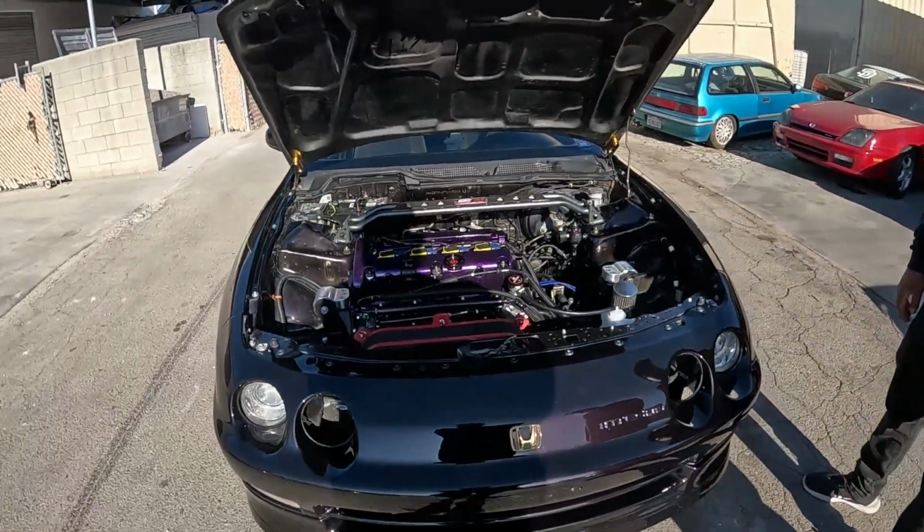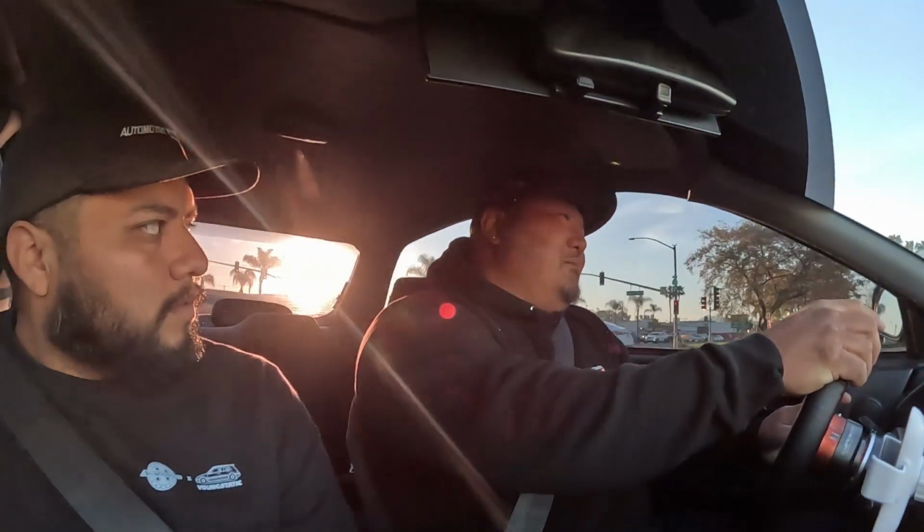But then you also upgraded tires. I saw that, it looks like a monster truck up front. Compared to the last video we did, my car was slammed, now my car is a lot higher. Because the lead motor mounts tilt the motor forward, the oil pan sits a lot lower, so it already hangs low. Before I raised it up, I smacked the oil pan once and it wasn't that bad, but the second time it was really, really bad.